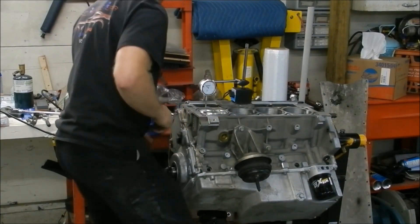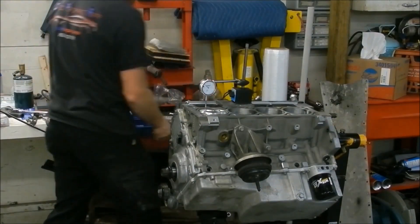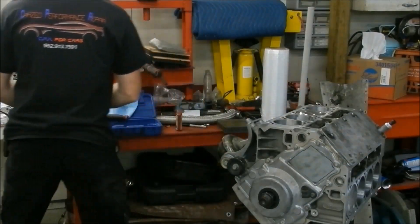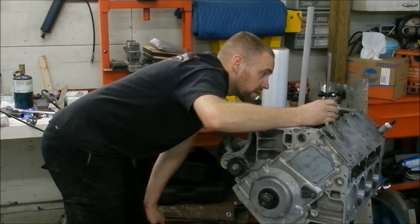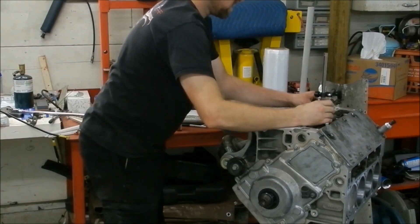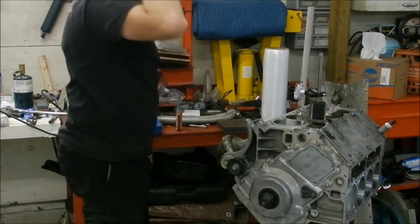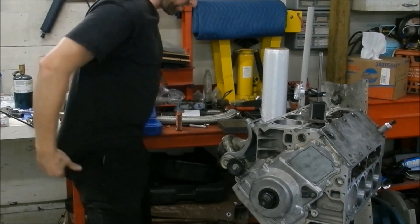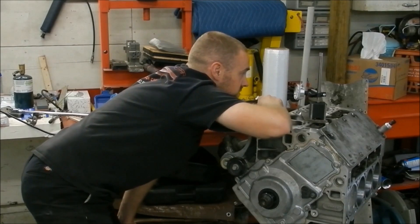I have to put that into figuring out my compression ratio, so I write that down. Cylinder number six is on top dead center - we have 12. Going back up to zero, we have 12 thou, and going across to the other side it's going to be a little different. So now I'm going to CC the heads and try to make sure I get the correct head on the correct side based on CC difference - 12 and 28.